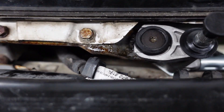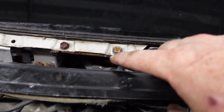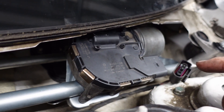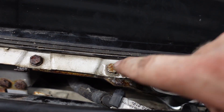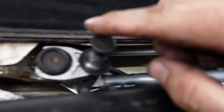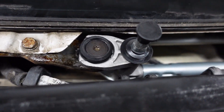We've got my two T30 bolts back in and my bracket back in. Something that did trip me up a little on the install - I was having a hard time because I put the bracket in first and then was trying to get this guy located and get that little pin back into the chassis at the top there. What I ended up doing was just removing this little bracket again so this end of the assembly had a bit more room to wiggle up and down, and then I was able to locate that pin and get that guy in. Once everything was in place, I settled it back to a normal spot, put my bracket back on and did it that way.